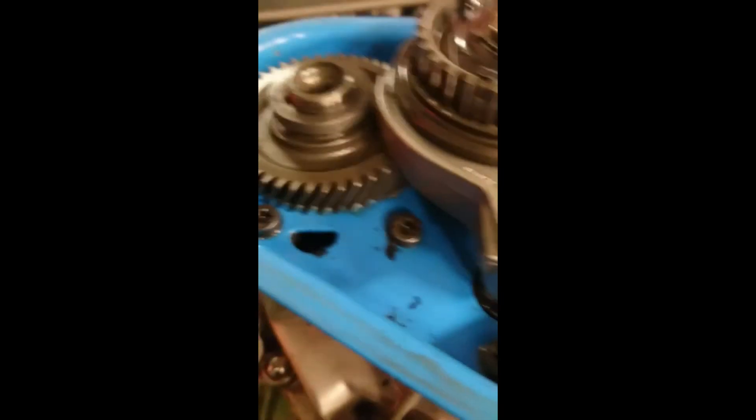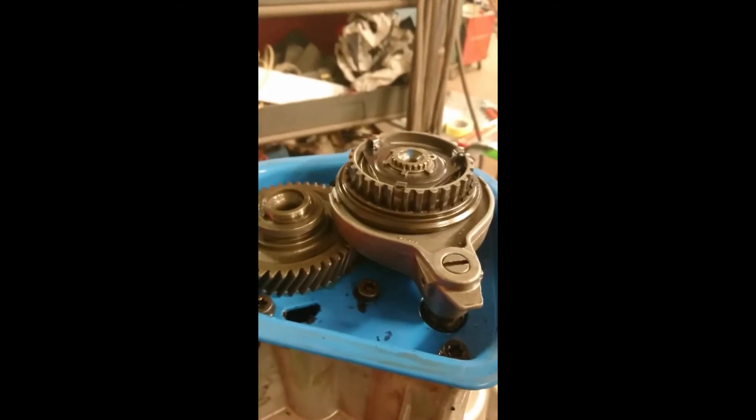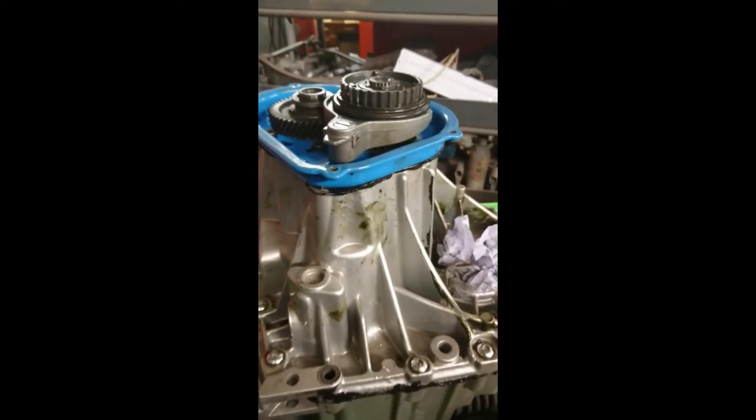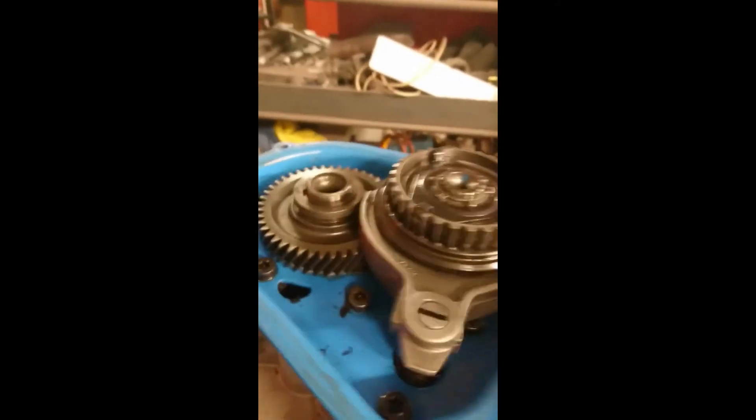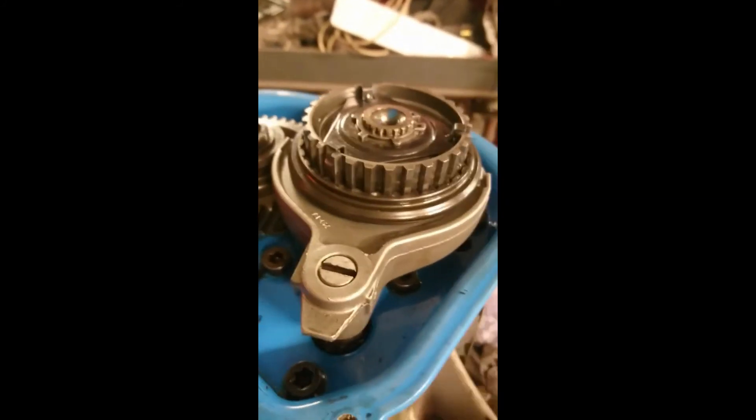Getting fifth gear in — a little tip if you're ever attempting one of these on your own: use a screwdriver to hold the rod in the right place so you can locate the roll pin in, because as you can see the roll pin is pretty much in line. Best way I've found is to get it locked into where fifth should be — up and backwards, or it might be forwards, one of the two — and that'll hold it in place. Otherwise when you build it back together that can disappear off in the wrong place, and then you end up stripping the box again or spending a good few minutes wiggling it trying to get it in the right place.